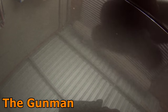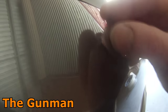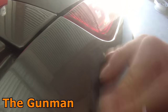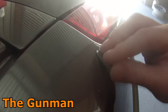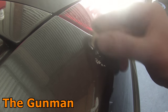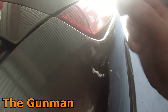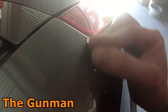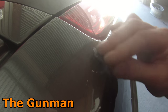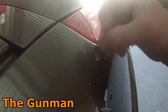What I'm using here is the tungsten de-nibbing block. These things are absolutely ideal for refinishing and polishing your paintwork. There's one little run here and I'll show you how I use this tungsten block on it. You really do have to be careful that it's dry enough - worst case it could start shaving in and rip the lot out because it's still wet underneath. If you're not sure, get your fingernail and dig into it. If you're still leaving an indentation, get the heat lights out or leave it an extra day.